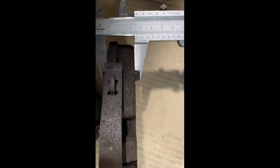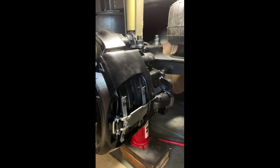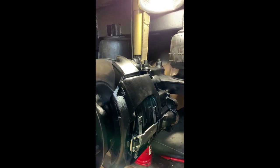I've been reading some of the comments you guys left. One was: how much pad life was left once this caliper bottomed out on the rail where the aluminum cap was bottoming out? The new calipers are 30 millimeters. The old caliper came out at 26.5 millimeters - so three and a half to four millimeters of pad wear is all I got before it bottomed out and jammed. The brakes would have faded more and more as that pad finally gave up. So 30mm to 26mm is what I'm seeing on my particular coach as a result of that foul condition - quarter life, if that, of the actual pad.